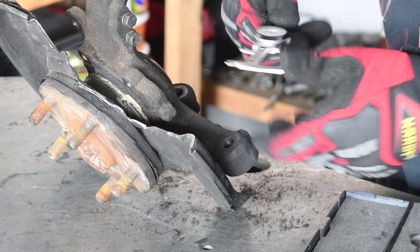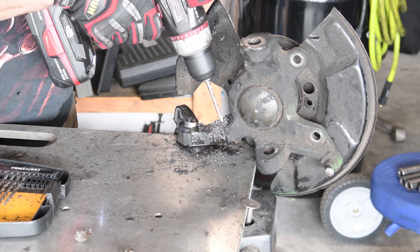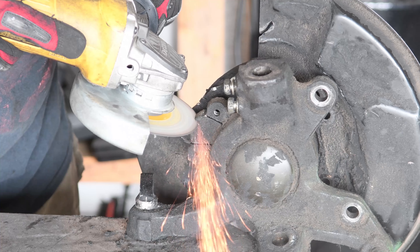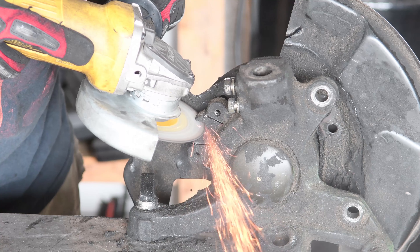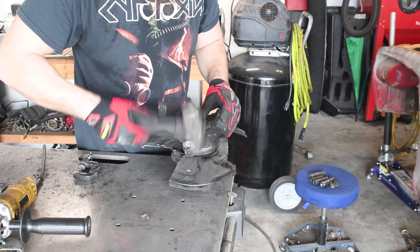In order to round off this homemade angle kit, I re-drilled the outer tie rod mounting point on the knuckle, but later went on with a different design that involved cutting the entire extension off for the tie rod and making my own. However, in the end, I wasn't happy with how any of it turned out.